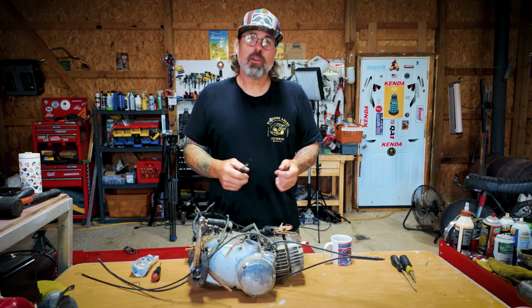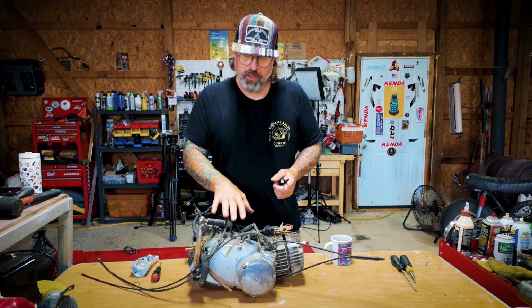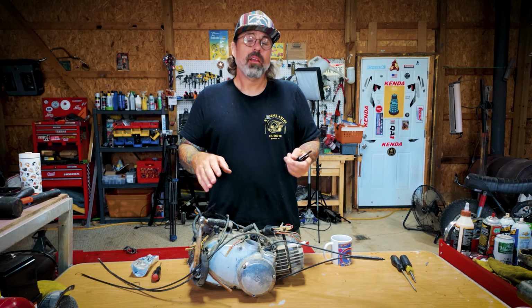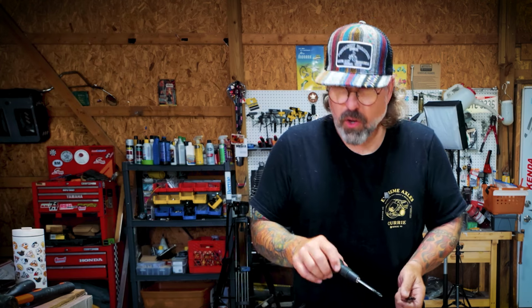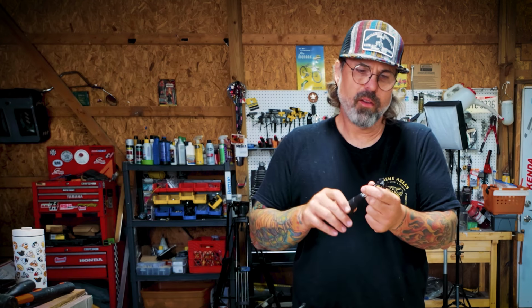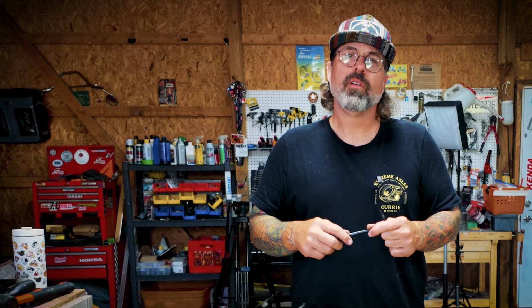All right, guys, this was just a quick one, but I'm telling you right now, JIS screwdrivers and old Japanese motorcycles go hand in hand. If you've never had them, they will change your life. Instead of 75% of the screws on a motor that haven't been touched in 50 years stripping, maybe one will strip. And if somebody else got their greasy mitts on your motor and messed up some of the screw heads, a lot of times you can still push them in there and it'll straighten it out. Seriously, one of the best bangs for the buck that you can do to make your life easier if you work on Japanese motorcycles.